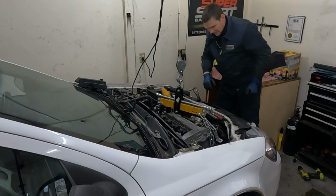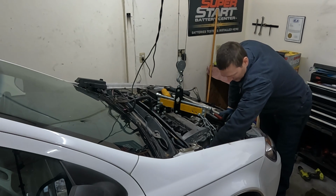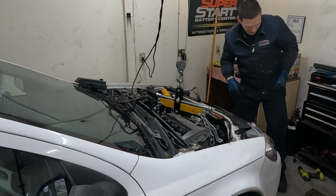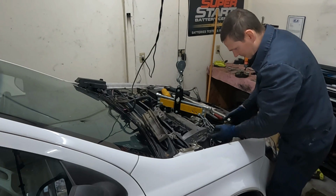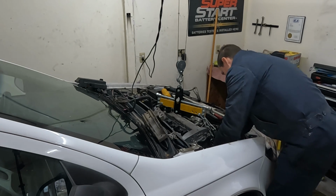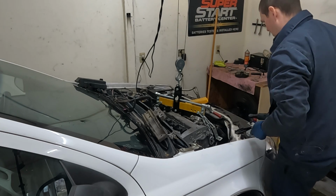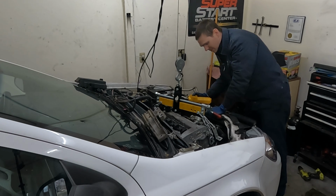There we go. Okay, so now let's put the front motor mount on, and then it'll be held on by the front motor mount and two tranny bolts, but we are all lined up perfectly. And the dowels are in. We're going to get this bad boy back on. Might actually lift the engine a little. So a little mistake on my part. This bracket should have gone in first before the engine went in. No big deal, we can still maneuver things, but that would be the best.